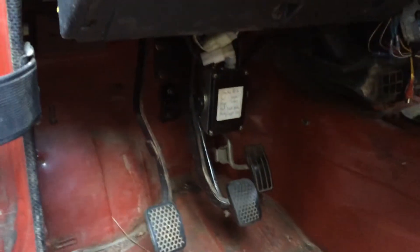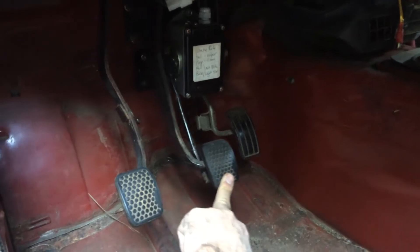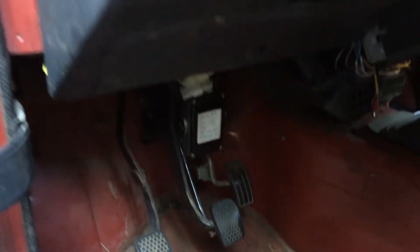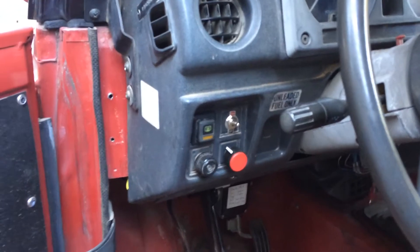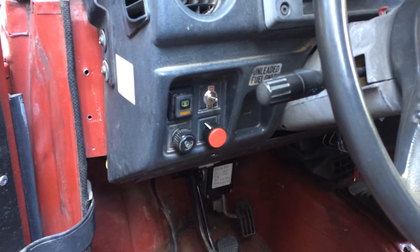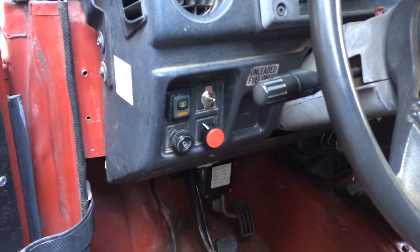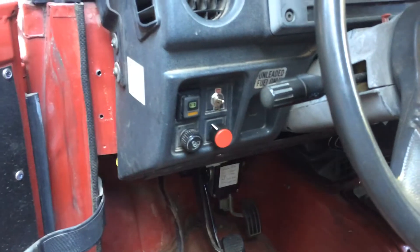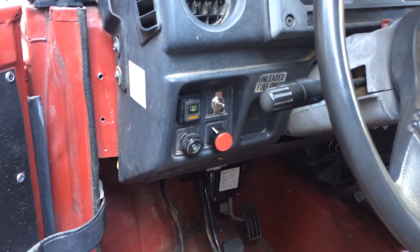I have my throttle, or brake pot for braking. The first inch and a half is all regen. And then I do have a bypass. I can run engine braking when the throttle is up. So when I'm wheeling and come off a rock or something, I just let up and use the motor as my brake to control it. I do have a switch here from a hard top rear defrost that turns on my blower to cool the actual motor.